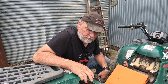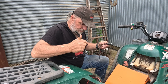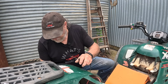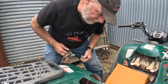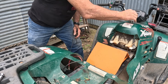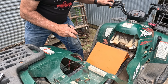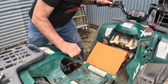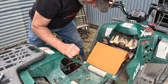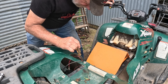I got the battery put back in it and got my test light. I'll start out by clipping on the negative side of the battery. I got power at the battery. I turn the key on and we can hear our starter solenoid clicking. I'm going to go down to the solenoid on the battery side, and I still have power when I hit the button.